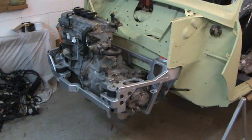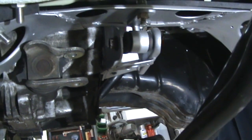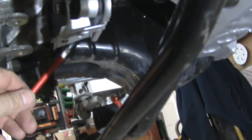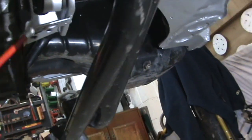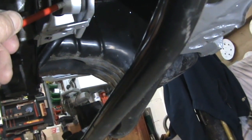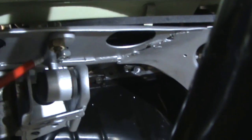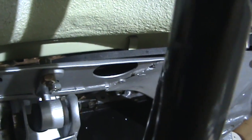The next job is to get the gear change done. I'm actually under the car now, lying down with the camera, so I'll try and keep things as steady as possible. Just to get the orientation - this bracket here is the bracket at the rear of the engine. That's a standard Nissan part, but modified. The piece here, just in the centre, is a little bracket I made - it's an old mini engine tie bar, so it's got a rubber mount in the centre and a little bracket on the back of it. I've welded on a couple of nuts and bolts to hold that to the subframe. This piece here, of course, is a new section joining the two halves together.